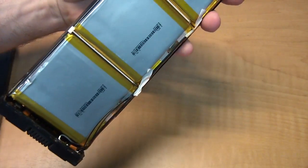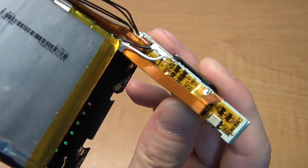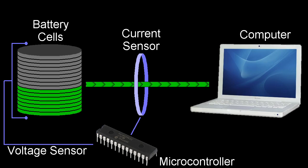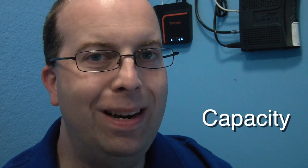We've covered the life cycle of a battery. Now let's talk about calibration. If you open up a battery, you'll find a tiny computer or microcontroller inside of it. This controller keeps track of how many cycles the battery has gone through as well as other information. Two of the things it attempts to track are how much capacity is left and the current state of charge. The capacity is the amount of power the battery can actually store under its present condition, and that shrinks over time as the battery degrades.